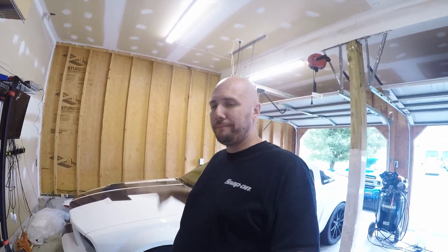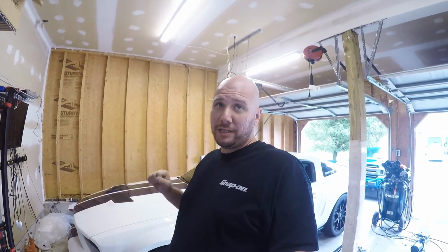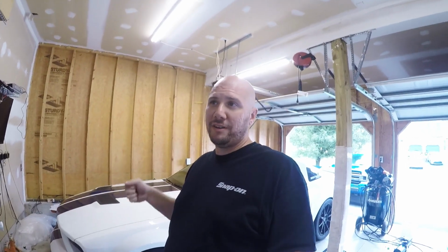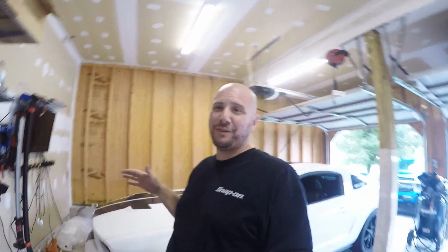So thinking about this a little bit more logically, again, you're going to hear me bitch about that MGW. I think that kind of made things worse, but I digress. That may be my imagination. So, logically, I solidified the MGW that bolts into the panel of the car, bolts underneath the car, makes the shifter nice and tight, and bolts to the front of the tranny. Problem is that the motor can still twist and move around under very high load, and the transmission can shift and twist under very high load.